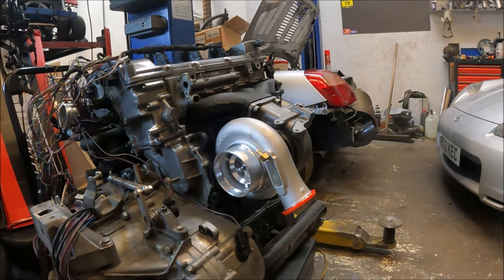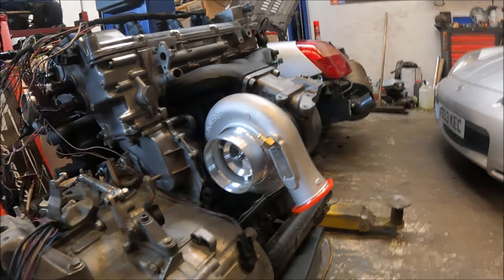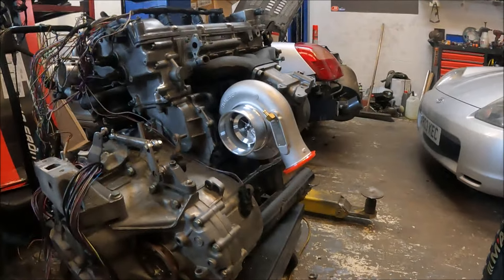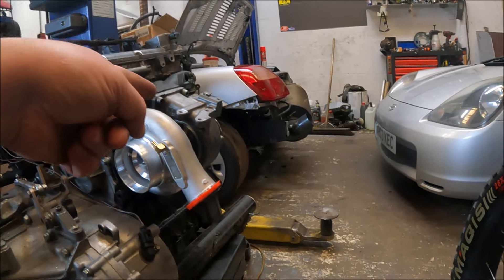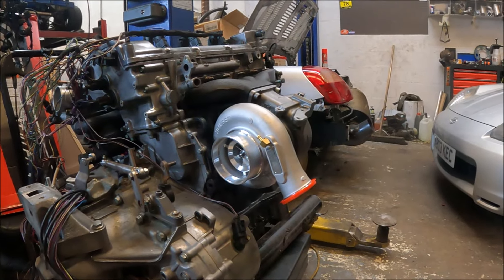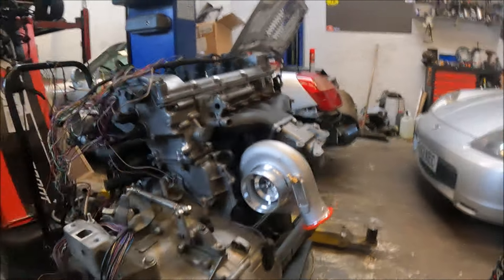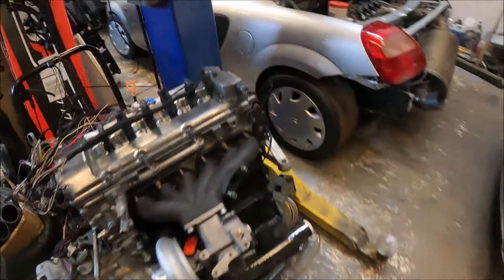It's like 55/85 if I recall, and normally they're like 54/76 and maybe 82 as well. So this is like a super-duper HX35. From the factory these are mega turbos for what they charge — around 500 quid for them. But people misunderstand the turbo sizing. They have the 12cm housing available too, which is the most common one for this size turbo, but people go 'oh why have you put an 8cm on a VR6, isn't that way too small?' — well this is what I mean about the sizing.